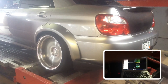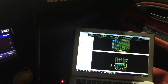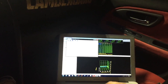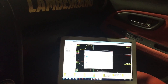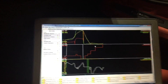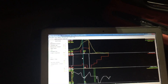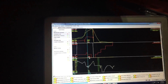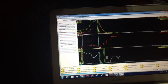All right, let's take a look at what's happening here. You can see there's no knock or anything sad going on — about 70% wastegate duty cycle, 25 pounds of boost, 25.04 psi to be exact. Ignition timing is pretty damn aggressive, not going to lie: 23 degrees going up to 32. That is ridiculous — that's way too much timing.